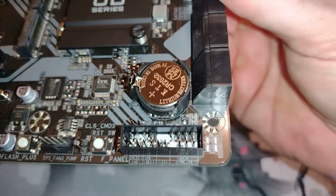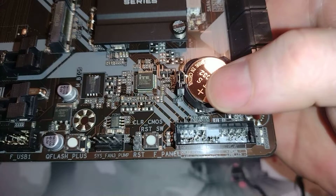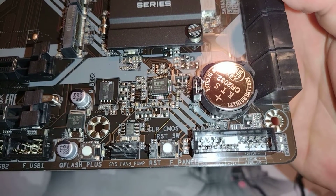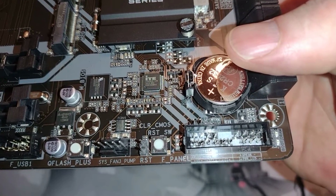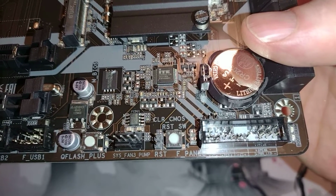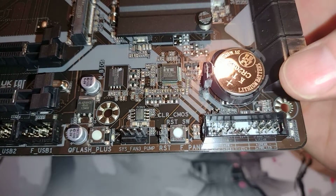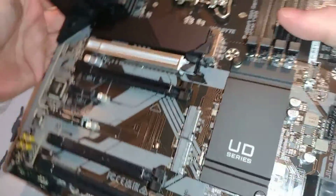Now, just in case you guys can see this, these are your front panel connectors. So you've got along the top left, you've got your power LED, then pins 3 and 4 power switch, and then the next row down, HDD, the first two pins, that light there, and then the reset is the third and fourth pin. Up above on this side is the speaker, all right? There is the CMOS battery, 6 SATAs, okay?